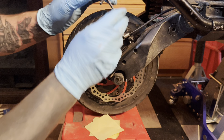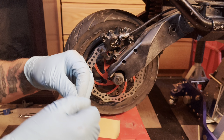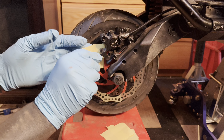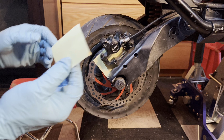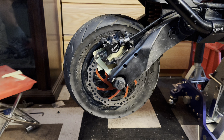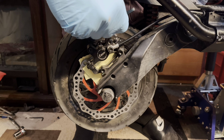These are hydraulic brakes and you can get them set up with a couple little pieces of paper. I'm going to rip off the sticky part of the post-it notes. I have two post-it notes and I'm going to slide each one on each side of the brake pad — so there's one side, and another piece on the other side. Now I have paper in between the pads and the rotor. I'm going to grab my brake handle, hold tension on it, and go ahead and tighten these down.